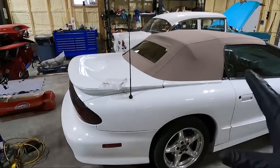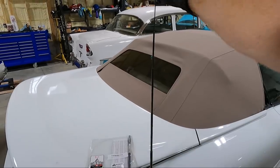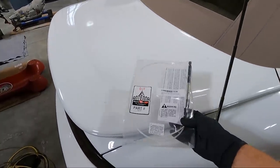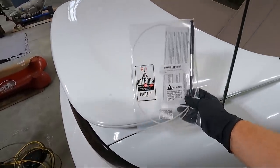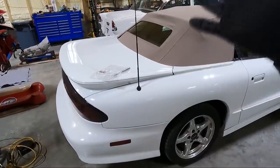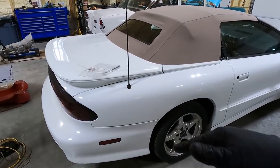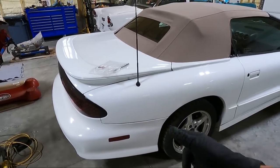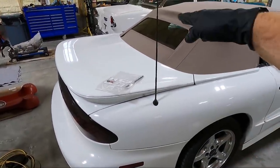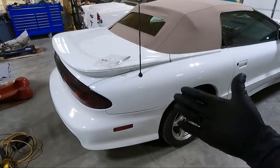I want to do little things at a time — clean under the hood, some brake replacement — but today I want to address the antenna. You can see it's up and obviously broken; the mast is broken. I have a new replacement, which I'll list in the description. It was under 40 bucks and it's especially made for these cars. If your motor is bad you'll have to replace the whole unit, but you'll know if the motor is good because when you shut the car off or turn it on you'll hear it. My motor works — it's just the plastic mast that's broken, which is pretty common.